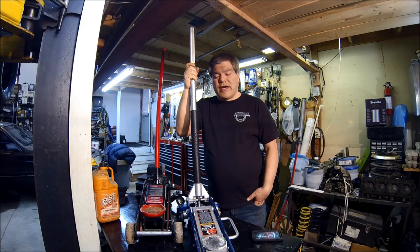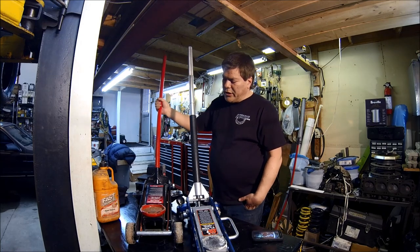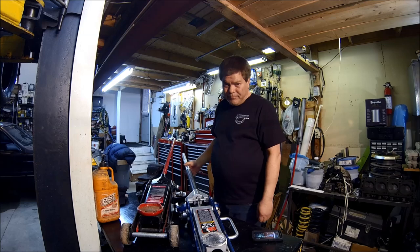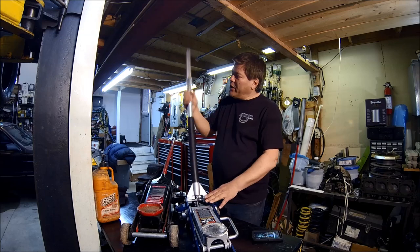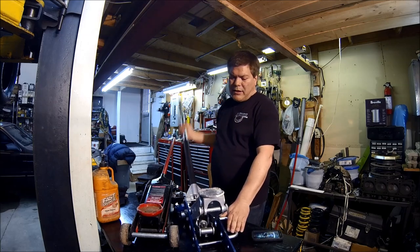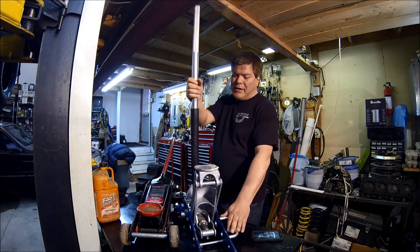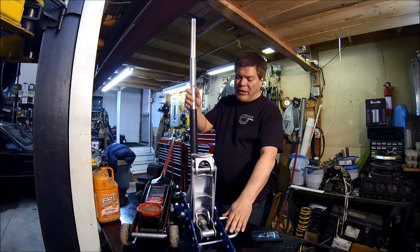But still, it's time on the track, so if you've got problems, you want the jack up as soon as possible. Typically, with a jack like these, you take a stroke, and they're only going to lift, as you can see, maybe half an inch, or in some cases not even that. It can take a while to get these things up. So you've already got three there, four, five, six, seven, eight, nine, 10, 11 strokes to get to the max. You're not going to get much farther.